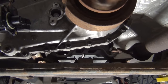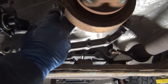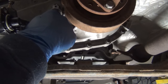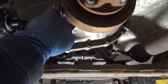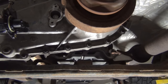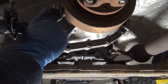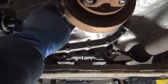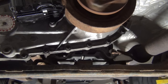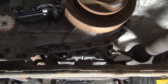You can see the button there. Slow it down to like five miles an hour. Yeah, so that's four-wheel drive. Go ahead and let it out. So it's engaged — we've got four-wheel drive. So it's going in and out. Maybe it was a problem with the transfer case. You can hear it go in and out. It's just hanging up. So all four wheels are spinning. If you look on the right side of the frame up here, with my finger wiggle, you can see all four wheels are going.